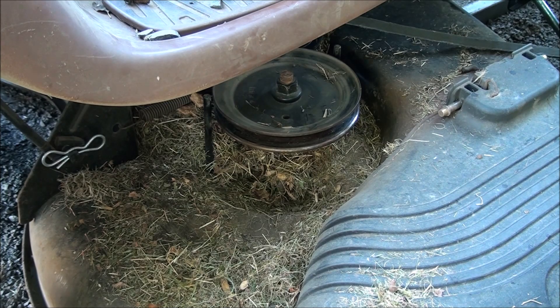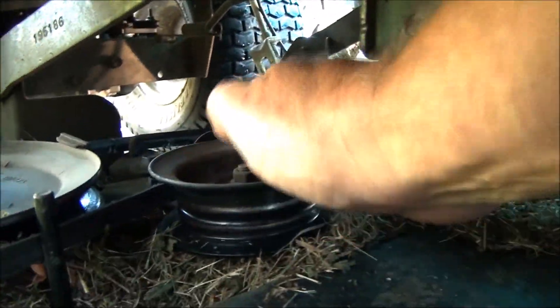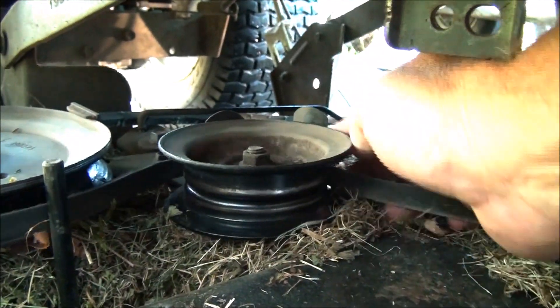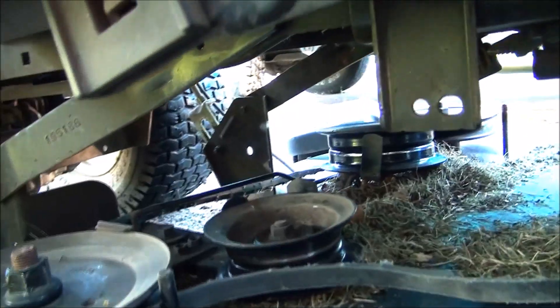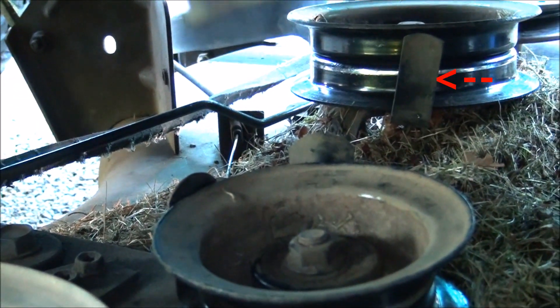Could it be that it was just an aftermarket belt? If you look back in here on your idler pulley you also have some of those keepers — that's it right there, just a little metal tab. It looks like there's actually one on this side too. You just want to make sure the belt is on the inside of those keepers when you put the belt on — which it is. You can see the other pulley over there has the same setup with those metal tabs that the belt has to go inside.